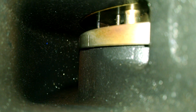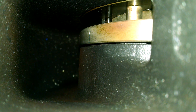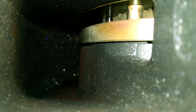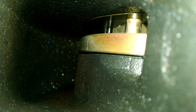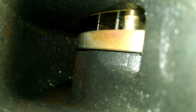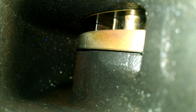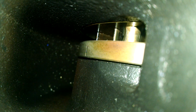And that's the difference right here between a VNT and a VGT. So if you're at maximum travel with the exhaust brake, these fins — the nozzles — should basically be flat. Now it's still going to have exhaust flow, but your drive pressure is going to skyrocket, and basically that's what causes your exhaust brake. And that is wide open, and on this turbo I believe that's a .84 AR ratio.